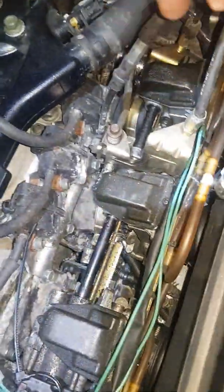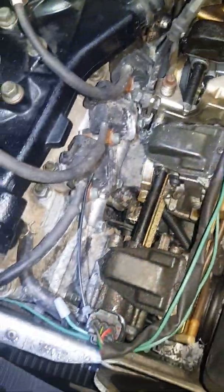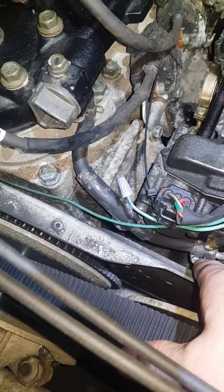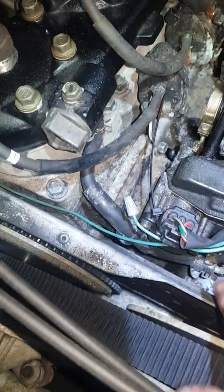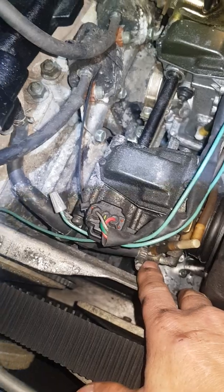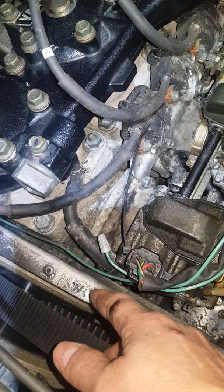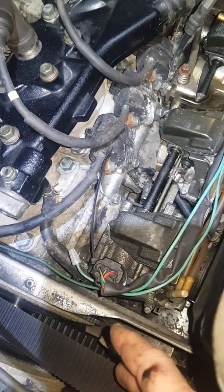That gives you access to the carburetors. On the carburetors, once you've loosened those three screws, you've got this coolant hose right there. It might be easier to take it off from there but you're going to lose some coolant. If you take it off from here you probably won't lose much coolant. But since we're going to be disassembling the engine out, just take it off here and let the engine coolant drain out into a pan underneath.